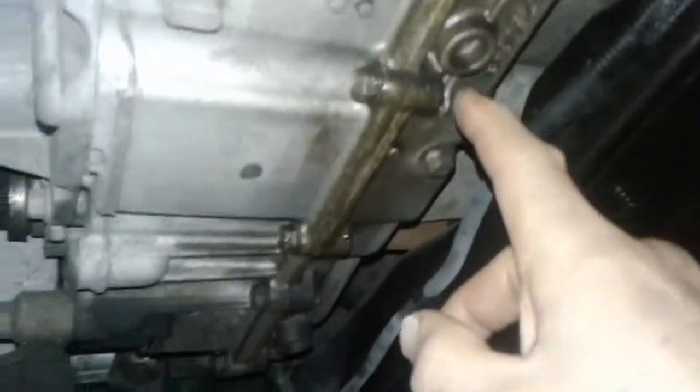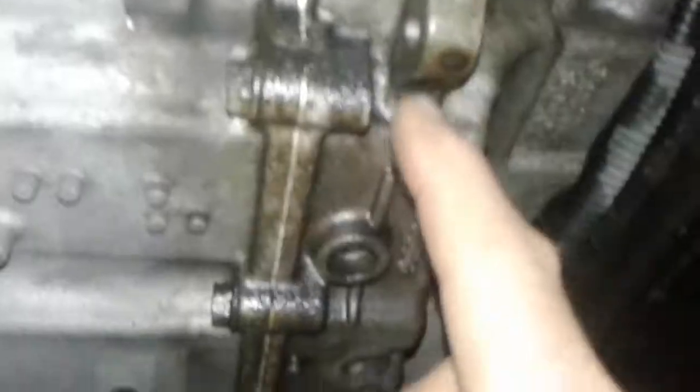Taking a scan beneath the motor — here's your exhaust, and this piece here is intact. There is a little bit of moisture but nothing severe as far as oil leakage goes. Most cars have a bit of moisture. Your oil pan is good and dry. Your transmission shows a bit of moisture but nothing that I can see is horrendous.